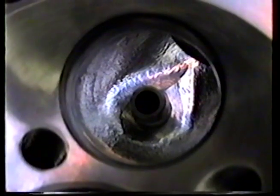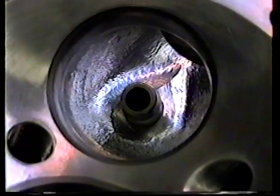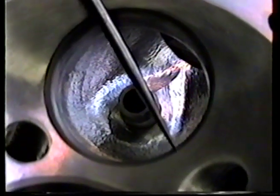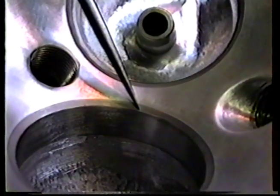We don't advertise any specific angles in this area right in here, but we've got them down pat — we know what works and what doesn't. As you can see, we're going on to a valve seat here which is 45 thousandths wide — that's what we use on the intakes. And if you focus down here on the exhaust, this is the one that's 60 thousandths wide.